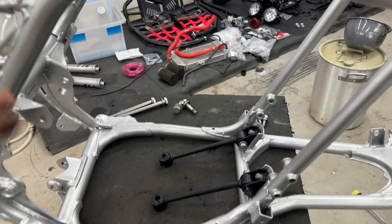The rear shock was basically just sitting on there so we're going to take it near here - the shock body cleaned up really really good. I did put anti-seize on my bolts down here. The rest of it is a bolt kit - none of it has any play, everything is nice and tight. I did have to destroy my swing arm bolt, so what I'm going to be using as a placeholder is the Raptor 700 one I have. It fits through there and we're not going to put a nut on it - once the new one arrives in the mail we'll replace it. We have our swing arm powdered the same color as everything else - the alien silver. We've got a new roller, the end caps Cerakoted with glacier silver, new bearings greased up, and the bushing going through.